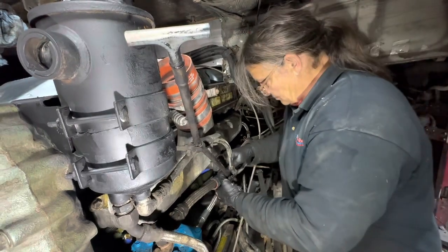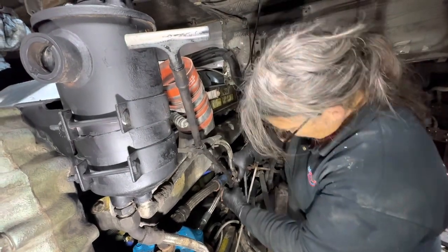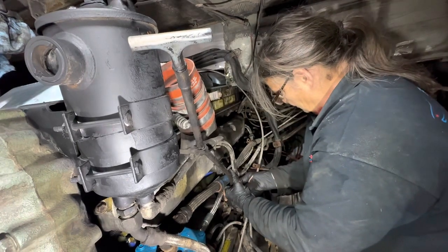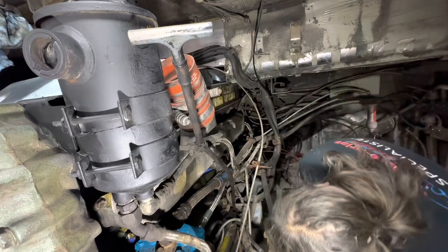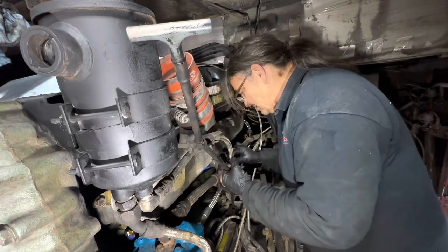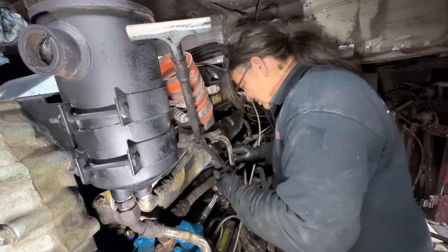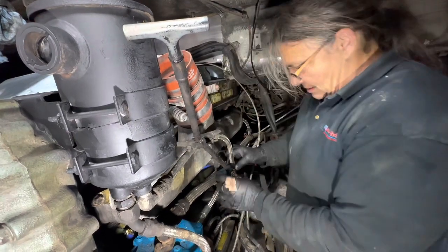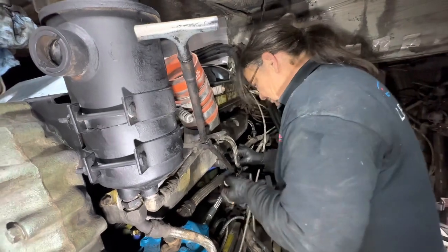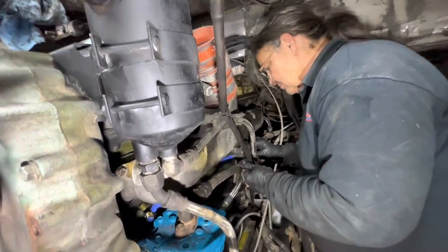So we're putting the clamps back on them, but at the same time, where two hoses touch each other, we're putting rubber between them. Yep. We put little rubbers and tie wraps to attach them so they don't damage each other. We should be fine. So we're making our bus more reliable.